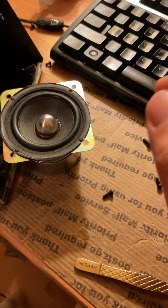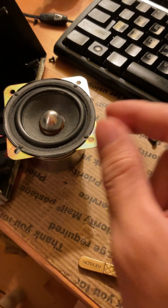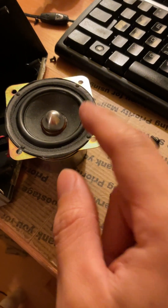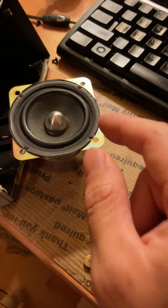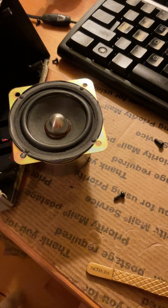When I bought this, I got it for $20, so I think there was something the seller wasn't telling me. When I bought it, the volume was turned all the way up. I believe this particular speaker was overdriven — the displacement was too large — and that's why this rubber gasket needs to be replaced.